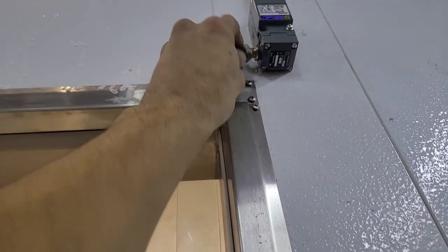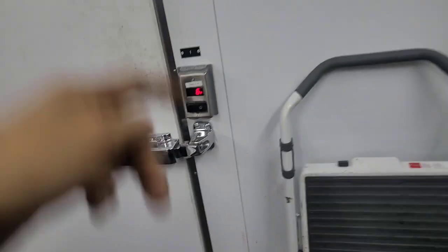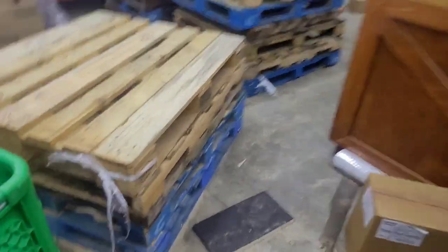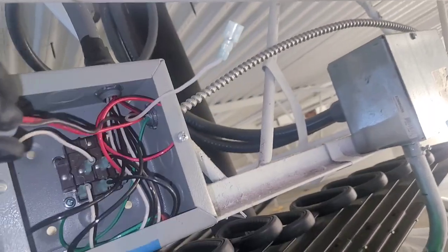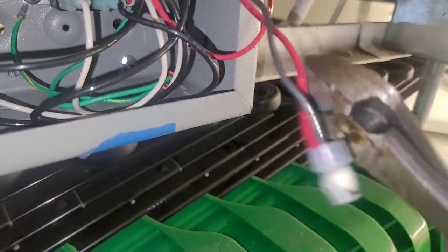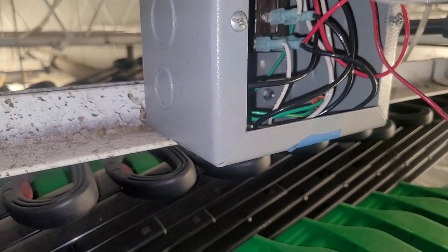The door switch is no longer doing anything because I have the wire pulled on that relay. We're gonna order a new one and come back to replace it. Back two days later — I'm gonna go up and kill power, make sure I've got no power coming to it. That's my wire going to the door switch. It kills the signal from the compressor. I'll isolate both wires, and now I know the door switch down there is dead.